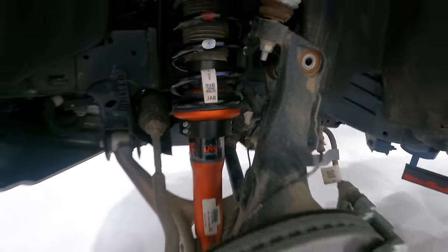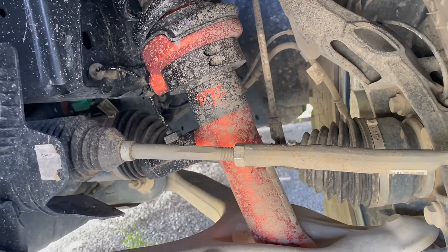I've been driving the Raptor for about four or five days now with the perch kit installed. It feels a little bit stiffer in the front, obviously because we've compressed that front spring a bit more in the strut itself — but it's bugger all. I've been driving the driveway in and out pretty hard, using all the modes over the past few days, and it pretty much feels the same. The only thing I've noticed is it's ever so slightly stiffer in the front, and when I've been jumping it, I feel like the springs are unloading faster — because we've compressed that spring and it wants to release that energy a lot faster. But the pistons are clearly still in the ride zone between the bypass ports, so we're not maxing out at one end.